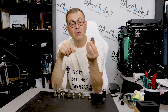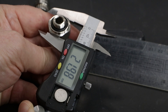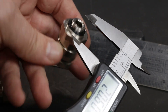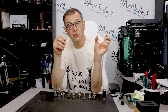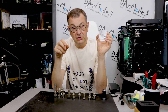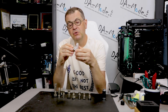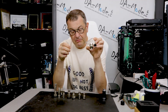That said, there are changes I noticed with the fourth generation: now almost all of them have this larger section on the bottom — possibly required for the cold-pressing manufacturing process. Especially for the male version, comparing old and new, the new one is quite a bit bigger. This can potentially create clearance problems when putting the fitting directly into components. For example, this is the top of the AlphaCool Core One CPU block, one of the most popular blocks, and you really need to watch the distance between the ports. I can barely fit those new fittings.